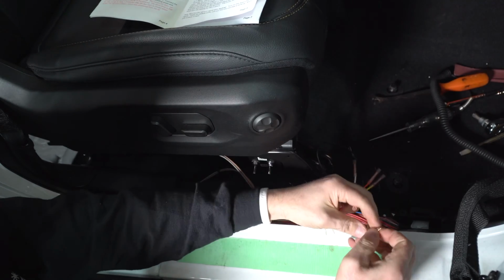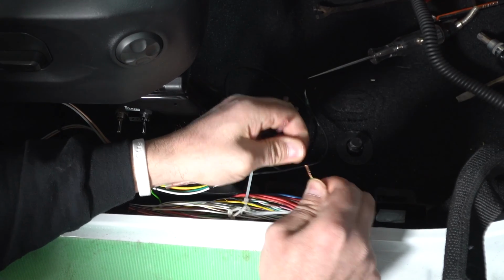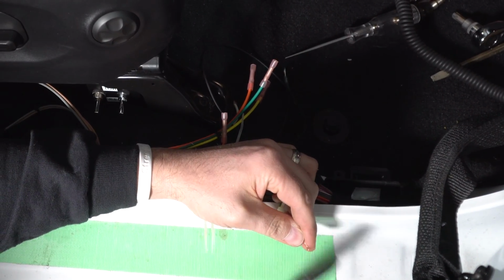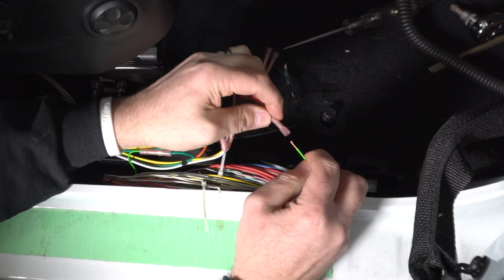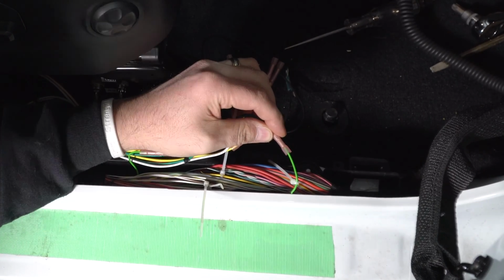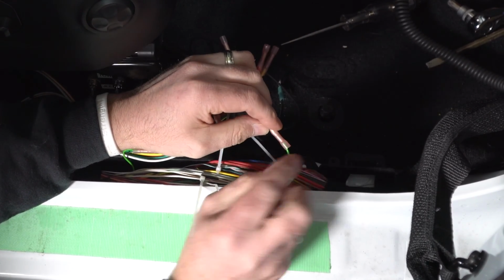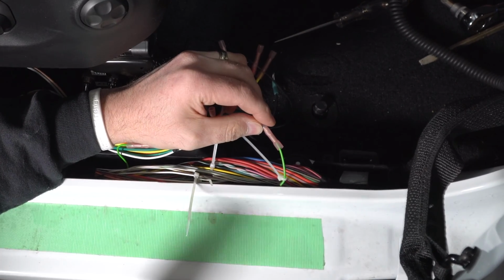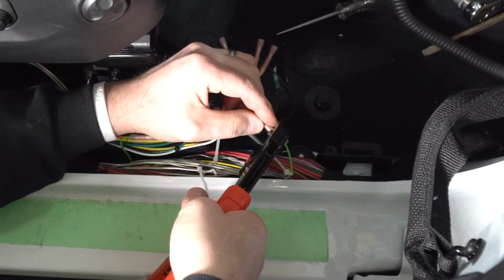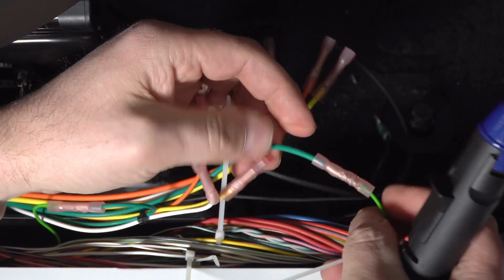And when you crimp it, we'll go ahead and crimp one right now. We'll show you. You're going to get that wire in there. Make sure all the strands of the copper go inside that center. I'm going to go ahead and trim this down a little bit because I've got more than I need. Where's my green one here? So we're going to get that in there. I got very little copper showing. Make sure it's buried all the way down into the bottom of that plug. When you crimp it, you want to crimp right between the center and not this outside either. Right there, from the center towards the edge, right where that flares out. We're going to go ahead and crimp it. Once and down, that's it. Nice crimp.